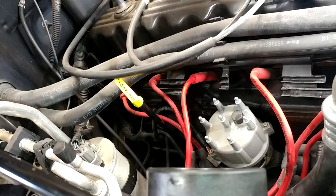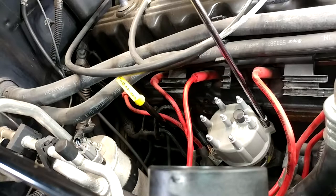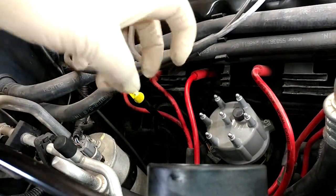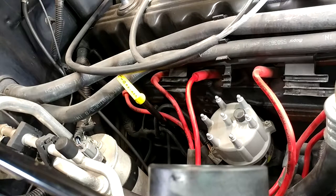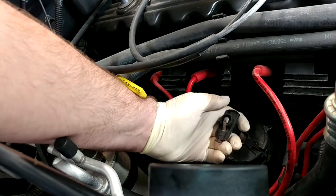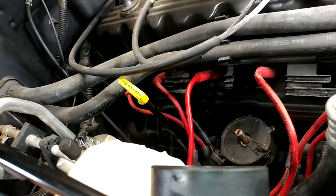Looks like we just need a Phillips head, but actually the bolts are hex on the outside — and our new guy uses 7mm, which is such a weird size. On a lot of other stuff like small block Chevys they're just little hooks that are spring-loaded and you have to push them down and turn them — I hate those. I much prefer the full thread. Let's get our cap on out of there. Our rotor looks like garbage — she's all rusty. The cap's not looking awesome either. The rotor just lifts right off, and usually not quite that loosely. Our distributor shaft is a little corroded.